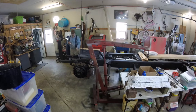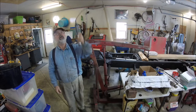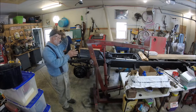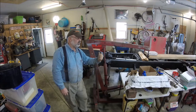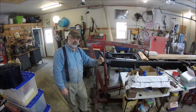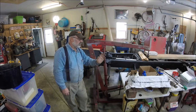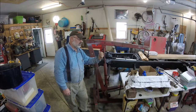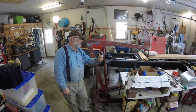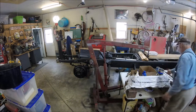Got the starter apart and sandblasted, cleaned up - they're all just kind of drying right now waiting. Once they get all dried up and I'm ready to go, I'll put it together, paint it, and then that'll be done. But right now I moved on - we're going to be installing the head on the block. I've already turned the flywheel around to where the number one cylinder top dead center mark is lined up with the pointer in the observation holes right next to where the starter goes in. We're going to wipe the block down one last time and the bottom of the head one last time. We'll get the head gasket.